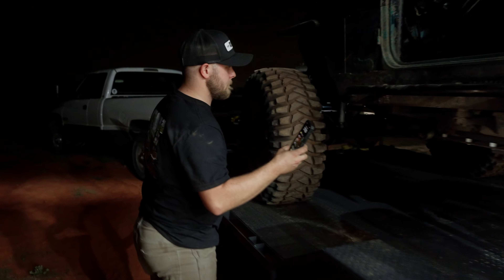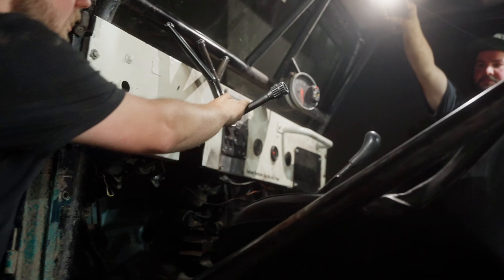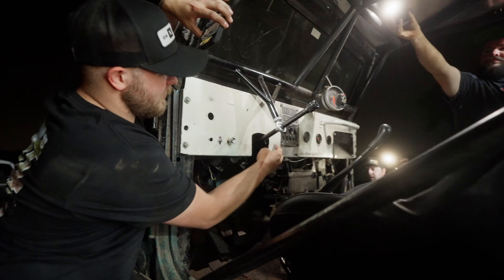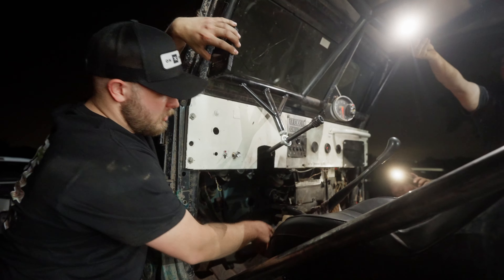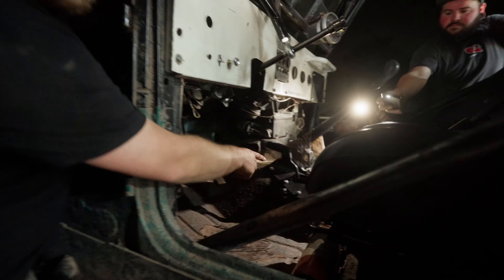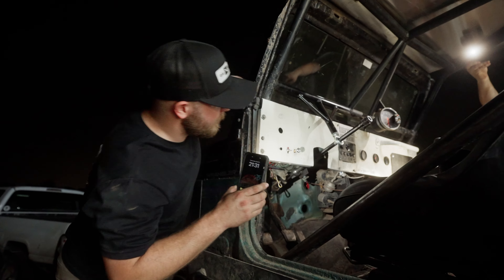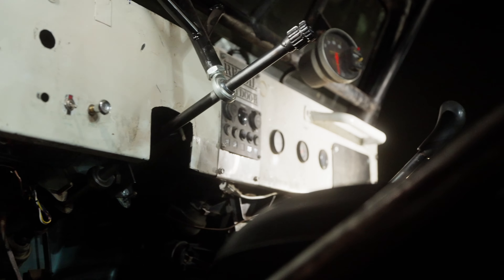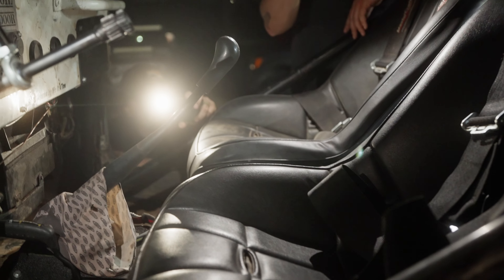Inside, we have a transmission tunnel cover. We've done a full steering column — got rid of the old TJ aluminum column, cut it, added in a couple of heim joints, a couple of braces and gussets. Now we have a quick disconnect wheel. Looking down at the trans tunnel, we now have a fully operational shifter. Brad made a custom ABS plastic cover, formed it for the trans tunnel to cover up all the holes. We've also got an ammo box for the center console, with a start switch and a kill switch that kills power to everything.